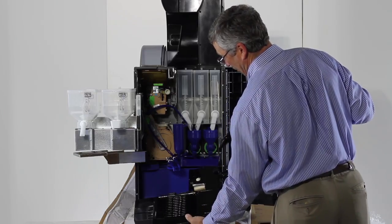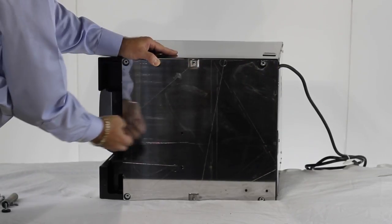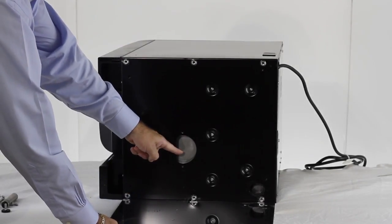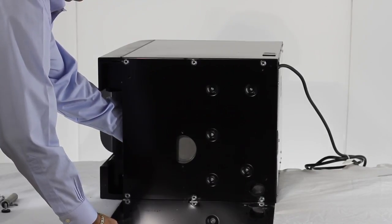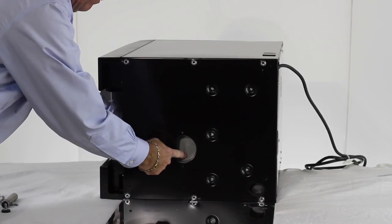Before mounting the CREA, remove the ground and liquid waste tray and carefully lay the CREA on its back. Remove the metal plate attached to the bottom of the CREA. The plate is held in place with 2 10mm bolts and 4 Phillips screws. Save the plate and bolts in case the CREA is used without the base again. The ground chute cover and harness routing cover can be removed after you remove the metal plate.